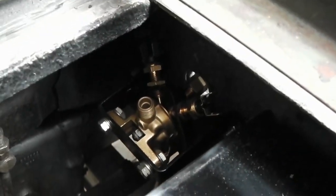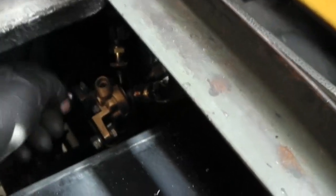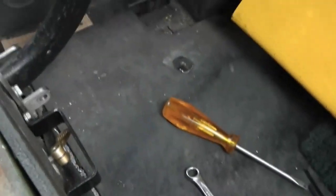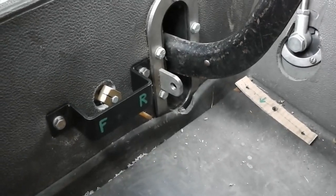I just need to put a little bend on my pipe stub that I made yesterday, just bring that up a bit, and that one is going to come off the auxiliary tank. I have actually just moved the position of the tap slightly higher up - about half an inch higher up - to help me get the handbrake lock on. There is room to do that and it just gives a bit more clearance underneath which is quite helpful. So that's worked nicely. Just making sure it clears the handbrake - nothing anywhere near, so we're all good. The correct position is really right in the middle of this bracket, but I've moved it up about half an inch.